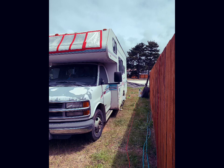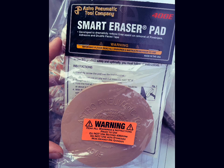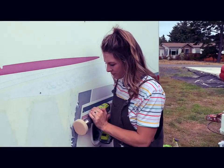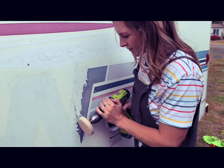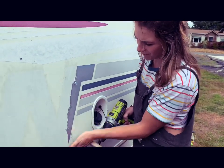There were a couple of options for removing the decals. You could either use a heat gun with a straight edge — warm it up and heat up the adhesive — which I did try on this one. It worked, but not as well as what I'm going to be showing you. It's called the smart eraser pad. This is definitely worth it. Basically what I'm doing here is I already attached it to the drill — it's like a big giant pencil eraser that gets the decals off. I did it from the side like this and it came off really nice.